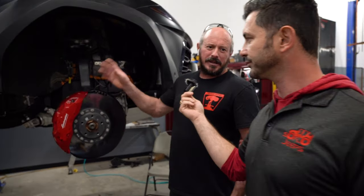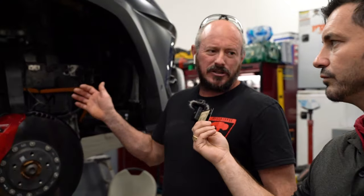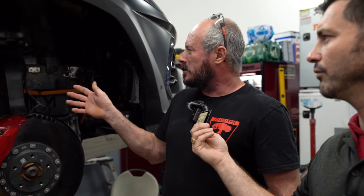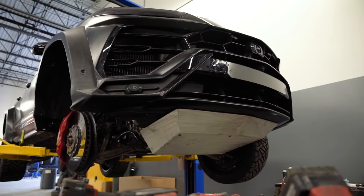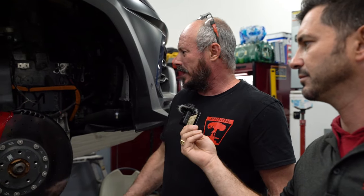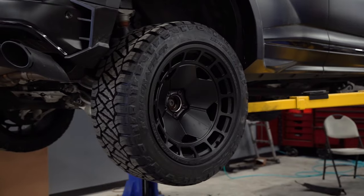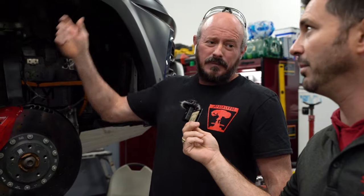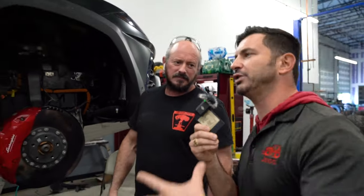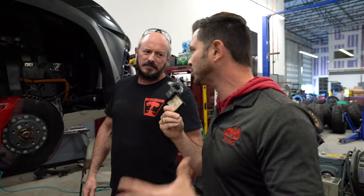This is a 2022 Lamborghini Urus. We have a five-inch lift on that, custom-made spindles, skid plate on the front. Now we have custom wheels also because nobody makes those wheels — forged wheels. How hard is this lift? You're lifting a Lamborghini Urus for the primary purpose of clearance so it can do some more off-road stuff. It's definitely going to do some off-road. How hard is it to do a lift? It's a custom thing — you have to take apart the whole thing. On this car, I probably have a month into it, fabricating, making stuff, fitting, making sure everything works. There's no lift made for this car, so we have to fabricate one.